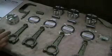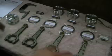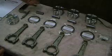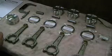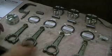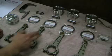You're also going to need assembly lube. The first thing I like to do when assembling an engine is lay all the basic engine parts out — connecting rods, the rings, the wrist pins, the pistons, and the ring locks. I label everything per cylinder, so I have these labeled one, two, three, and four.